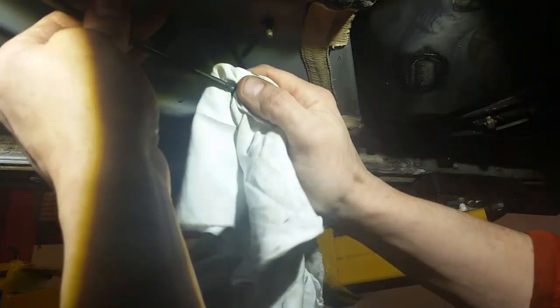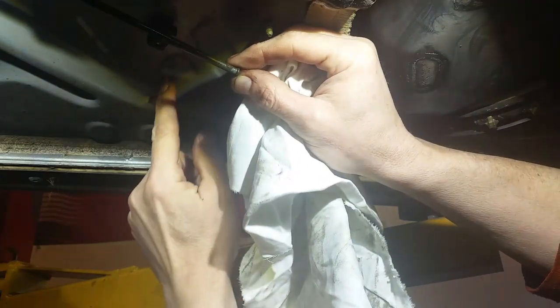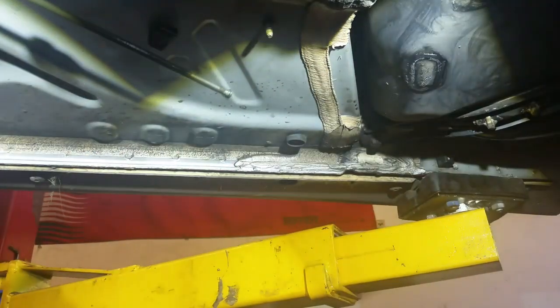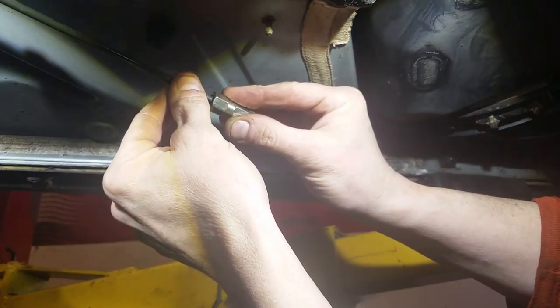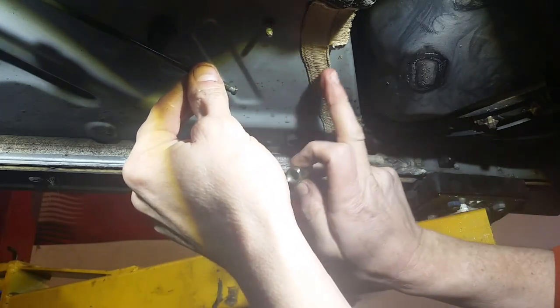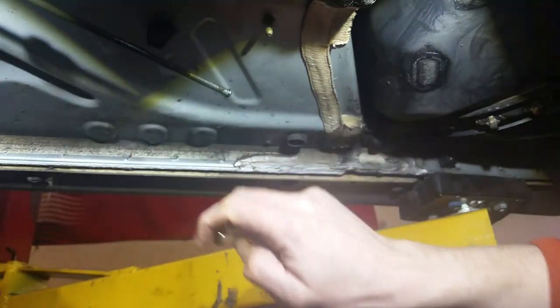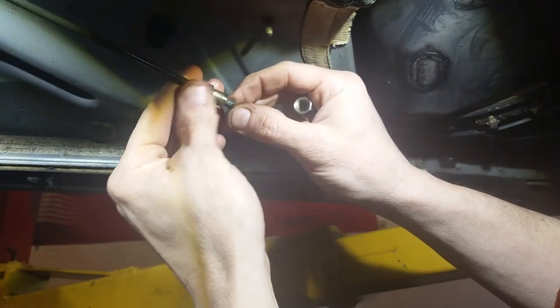So what we'll have is a 90-degree shoulder. So it's a straight, flat shoulder at the back, and a convex flare there. That is going to marry up with the concave inside here, you know. So that's how you get your seal. That surface there goes into that surface. So that's your mating surface there. So pull that down. The 90 degrees is very important. 90 degree shoulder. And that goes onto there.